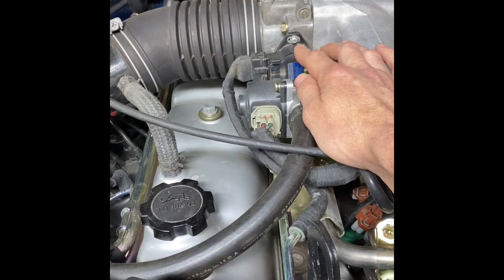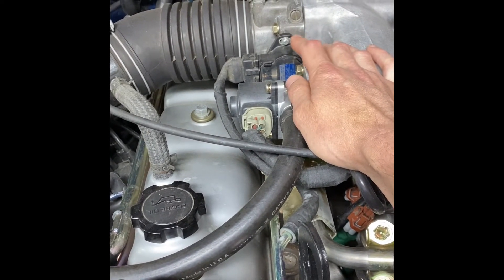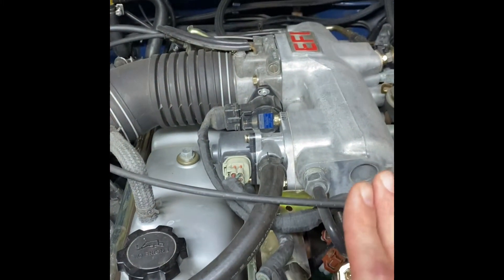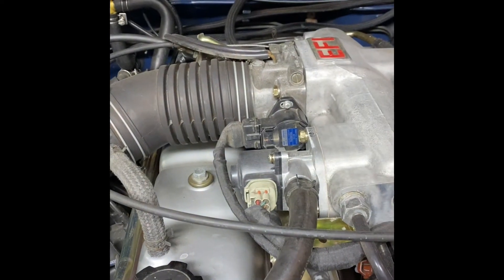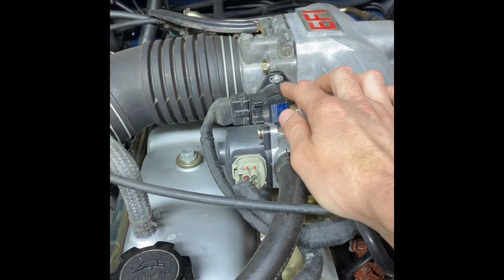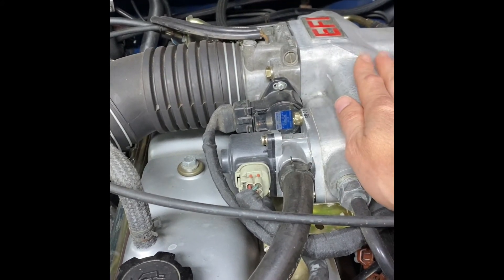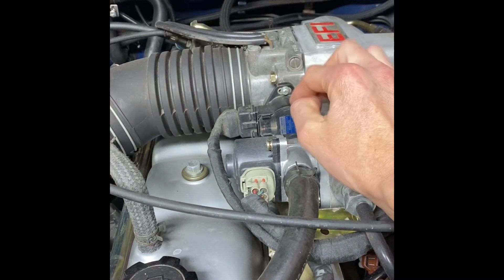To adjust it, you'll need a 0.77 millimeter shim and a 1.09 millimeter shim. The ideal way to adjust the throttle position sensor is to take off the throttle body — it's kind of a pain and you should invest in a new throttle body gasket for the intake manifold — but it's way easier to adjust on the bench. You have to get the shims on the other side for the set screw, loosen it just enough to slightly turn it to the right position. My advice: take it off the intake manifold and do the bench adjustment.